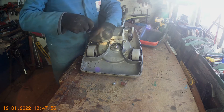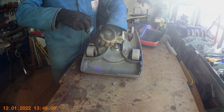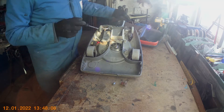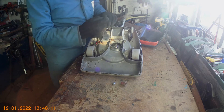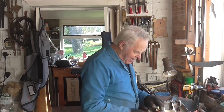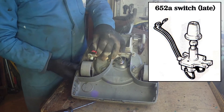So I'll take that little screw out there and there's one screw in the side here. I remove that and the cover just comes off like that. You can see the switch here — it's held on by the screw that holds the cover on and also another screw here. I'm just going to undo that one screw there. Watch you don't drop the screw somewhere you can't retrieve it. There's the switch loose and you can see the type of switch it is.